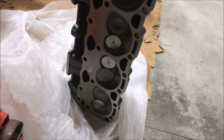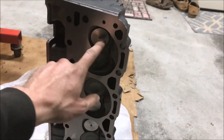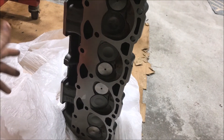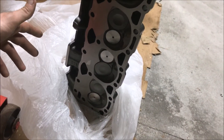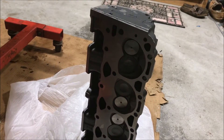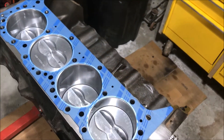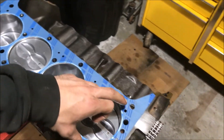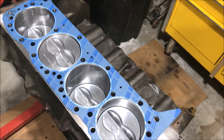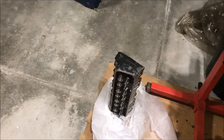You can see the valves - they aren't huge but they're good. These heads are known for having a pretty small combustion chamber and they flow pretty well, which is why I went with them, and they're cheap. I washed them off and put them in a bag just to keep them safe from the elements. I already wiped off the top of my block and wiped off my pistons. I've got my head gasket here right side up, so I'll get that on.